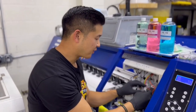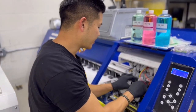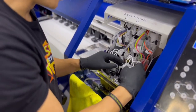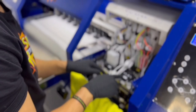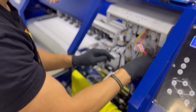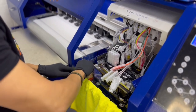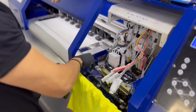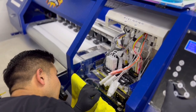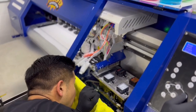What I'm going to do is cap off all the white dampers here so I can access the printhead that I need to clean. Gently remove the dampers, cap that off, and expose that as well. I'm going to put a little plastic container underneath so I can catch any of the solution that drips through. Then I'm going to jog the carriage over so that the printhead is going to sit right on top of the bottle.